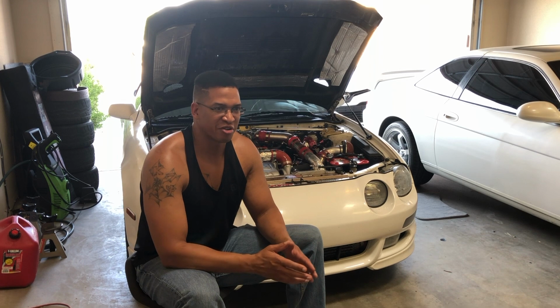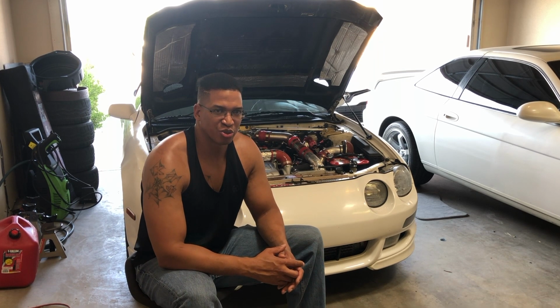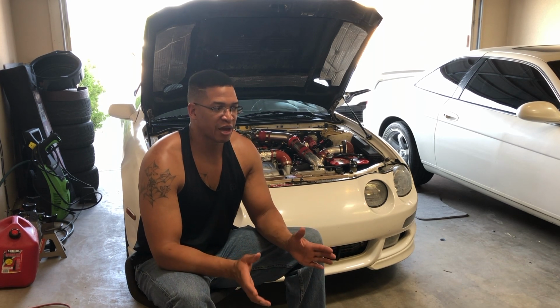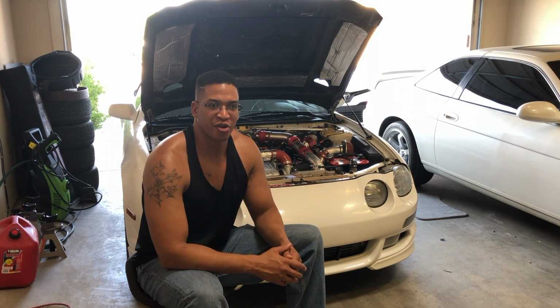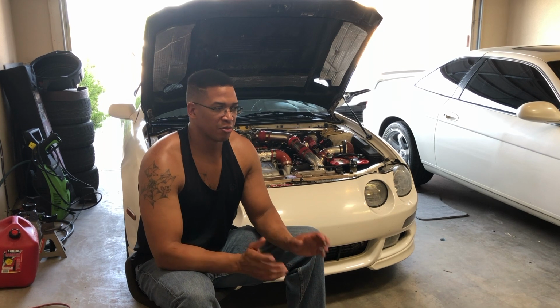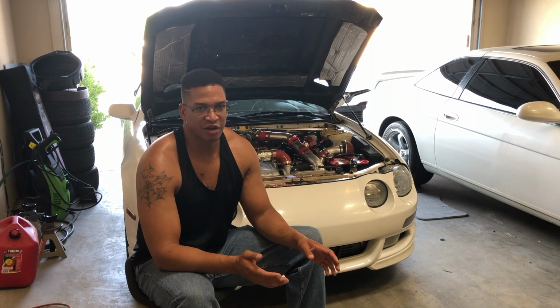Running, you've dynoed it, you're having fun, maybe you got a boost controller on it, and now you're looking to do some upgrades. Some good upgrades to do on this engine. I mean, if you want to take it back to the very beginning when the motor's out of the car and you're looking for maximum horsepower, the best thing to do is if you can upgrade your piston and rod setup while you have the engine open.